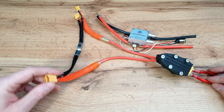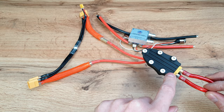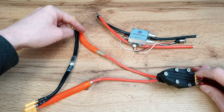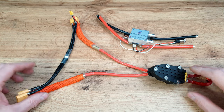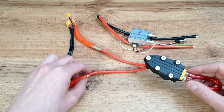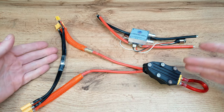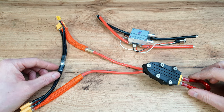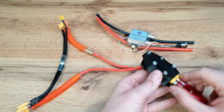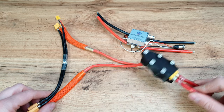So once again, how it works: we connect the battery, and the red wire which is positive goes through this wire, goes inside this box where there is an XT90 connector, goes around this wire, and goes to the controllers or other stuff like lights. There are no electronic parts, there is no magic — it will almost never break. There could be some mechanical damage, like cutting the wires or overheating the wires or connectors, but that's it. This is the easiest and safest way to secure your scoot. You can use a soft switch which is even easier to use and doesn't need a big adapter mounted outside, but this hardware loop key is more safe because there are no electronic parts.